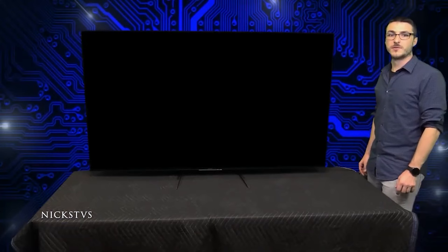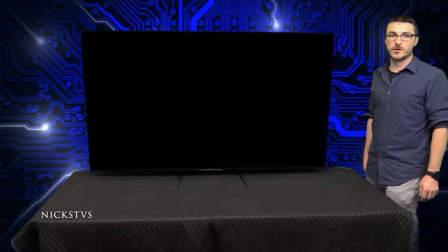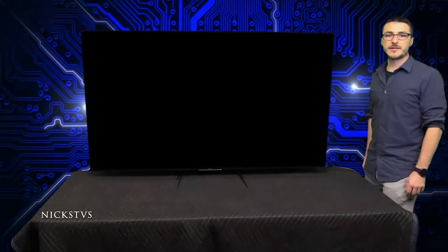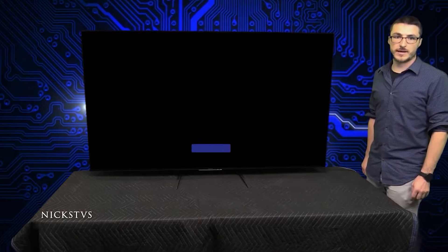Now the symptoms. Number 1: the TV seems completely dead — it won't power on, doesn't respond to the remote or the buttons on the back, and the standby light never turns on. It essentially has the same functionality as if it were unplugged. Number 2: when turning on the TV, the pilot light shows a white light for about 5 seconds then shuts off. Sometimes it cycles back on and repeats; sometimes it stays off. We've also seen a dark blue or almost purple light as well.